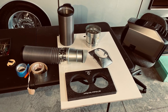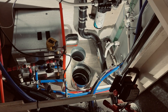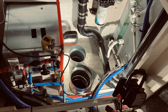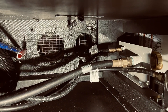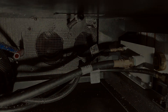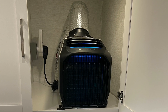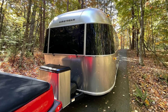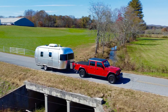While installation will vary coach to coach, I had to relocate a ton of plumbing under the cabinet to allow the ductwork to exit under the coach, hidden from view. When cooling, one exhaust duct pushes hot air outside under the coach while the other duct intakes cooler air for the condenser. Since the plastic exhaust ducts release unwanted heat in the coach, I insulated the entire duct. This is now the third Wave AC system I've installed in RVs with great results, offering clean air and comfortable sleeping while off the grid.